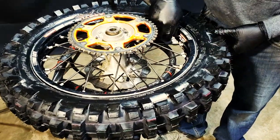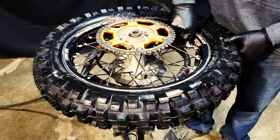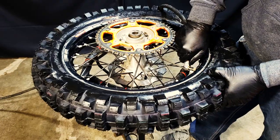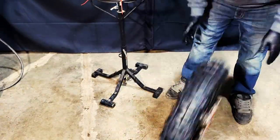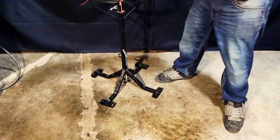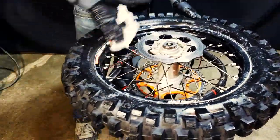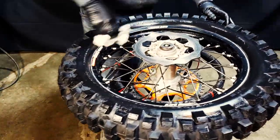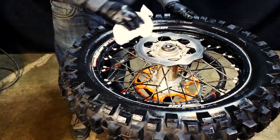Here I'm filling the inner bladder to 110 PSI and I'm going to fill the outer bladder to 30 PSI to seat the tire. Once everything's pressured up I'll bounce it on the ground a few times just to seat everything. That's it — done deal. Clean up with Mothers. The good thing about Mothers or Armor All is it makes your tire look real nice and makes everything smell good too. Thanks for watching — if you found any of this helpful, give us a like and subscribe.